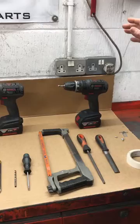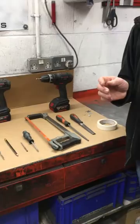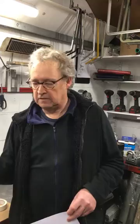Couple of things to take on board. I get asked a lot, can the trim be fitted after the car is painted? And the answer is yes, it can. In fact, out of all the buses I've built, the one you're about to see is the only one that we fitted before the car is painted. But obviously it makes sense, if you've got time in your schedule, to fit the trim before it's painted, then if you do scratch anything or mark the primer, it's not going to be the end of the world.